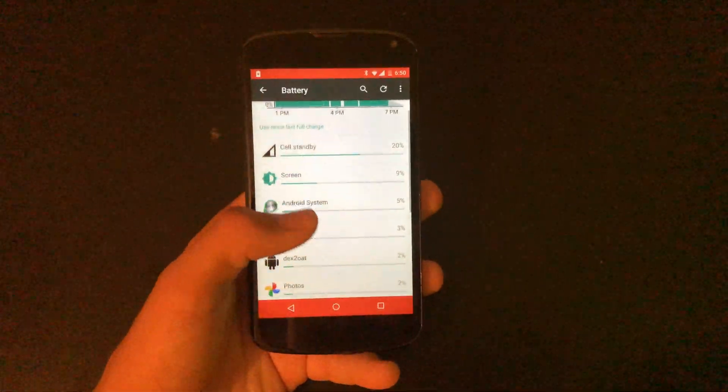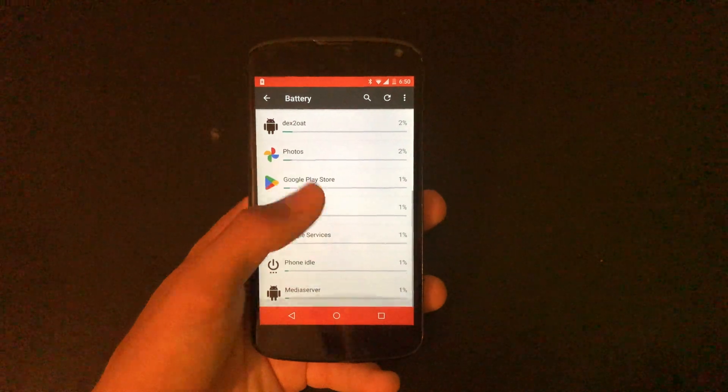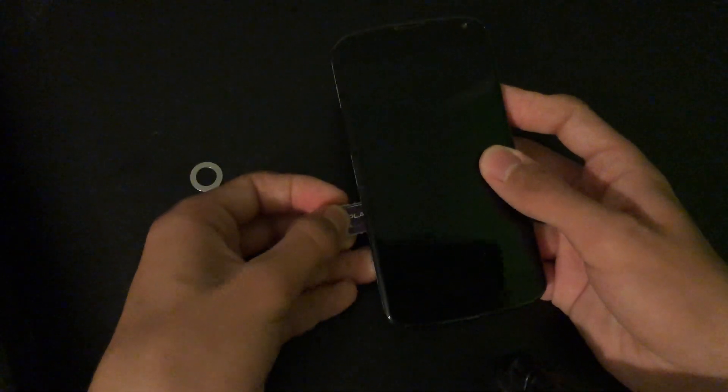The phone's battery is a 2,100 mAh LiPo, which can be charged with the earlier mentioned micro USB port or by placing the phone on a wireless charger. There is a headphone jack and a single micro SIM slot, but sadly no expandable storage, which is standard on Google devices. This device also features a Snapdragon S4 Pro SoC with 2GB of RAM and 8 or 16GB of storage.